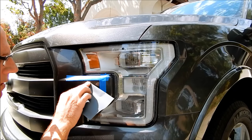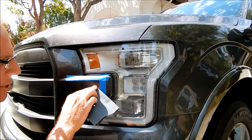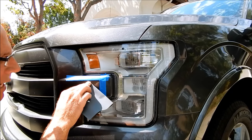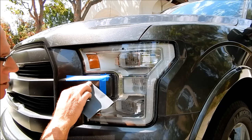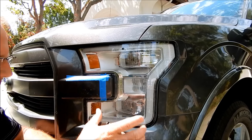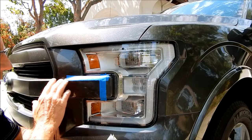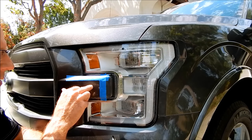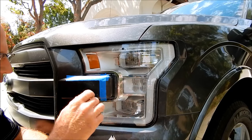Hopefully there'll be a few nuggets of wisdom you can take away. The point is you finesse it — pick the sandpaper, know your tools. With a rotary polisher I could stop right now at 1500 grit and remove those sanding marks to perfection; it would just take a little longer. But I'd rather sand through the grits because sanding is quicker than polishing.